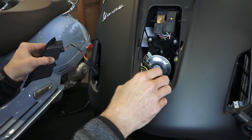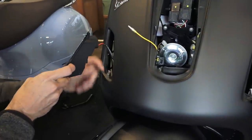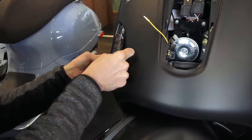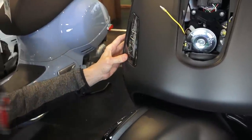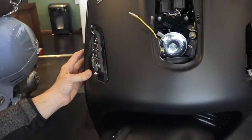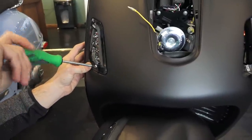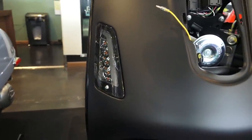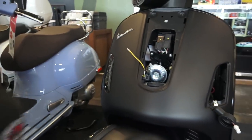And then go ahead and you put the turn signal in place. I would suggest tucking the connection up in the front area of the leg shield so you don't see it through the radiator grill. Go ahead and pop the signal in place just like the stock one. There's a single plastic tab that engages in the frame, and then you can use the Phillips screwdriver to install the single screw. And again, we have a black version of the screw. See the part number in the description. Pretty inexpensive, looks a little bit better than the silver screw, but I'll just show you that's the stock screw that comes with the turn signals or with the scooter, and it works just fine.